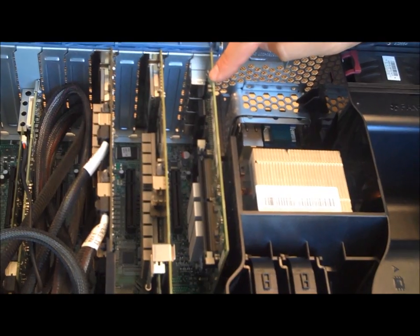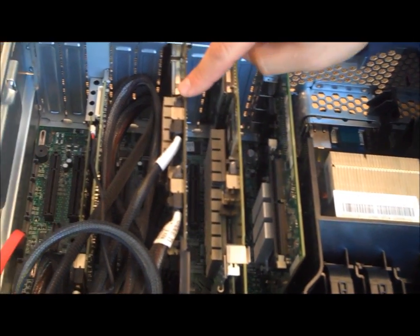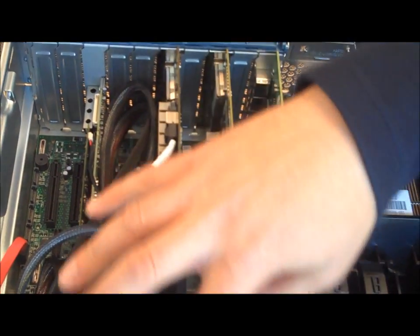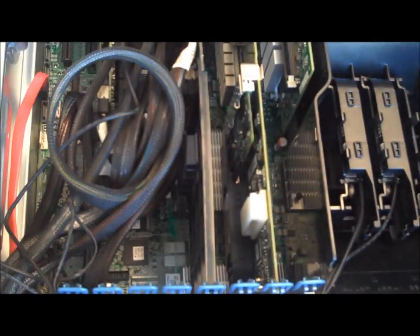There's a network card, and then we have the external SCSI card. This is the SAS expander card — we need this to power all those hard drives in front; you can see all the cables here. Hooked to that is an actual SCSI card, and over here there is an internal SCSI adapter that a couple of the drives are hooked to. Down here you'll see there's 96 gigabytes of RAM. We picked the hardware configuration and the software to give you maximum IO needed for your data warehouse workload and to run data warehouse queries.